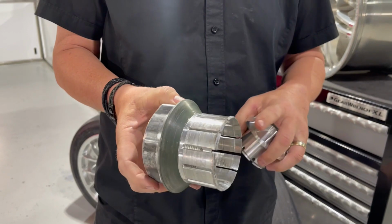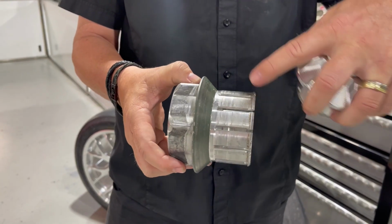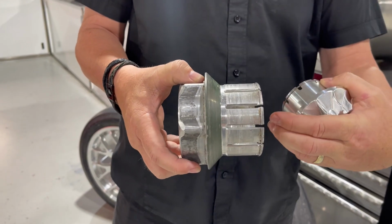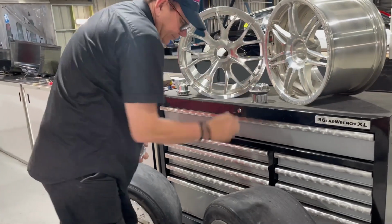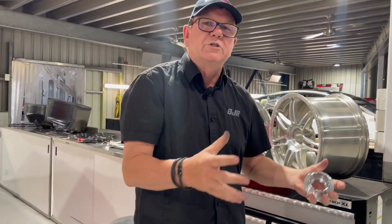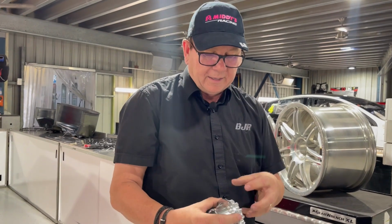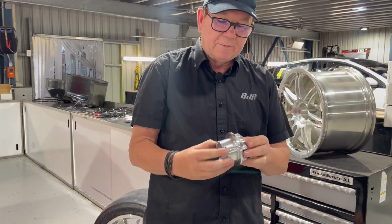They both are retained in the wheel, so you can see from the old style one we have tangs which are cut and then they go in and then spread out, so when this nut is in the wheel it won't come out. So it's retained and then the wheel gets pushed onto the car in a pit stop and then they come on with a rattle gun and do it up. Very similar process to be followed here.